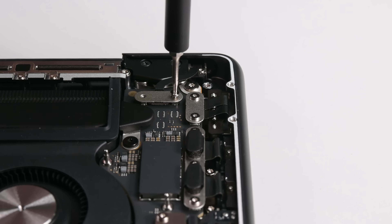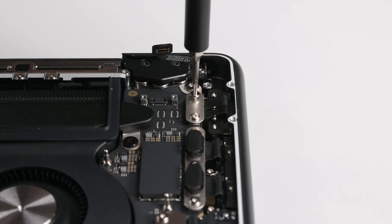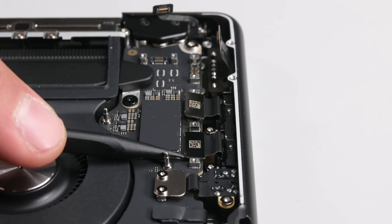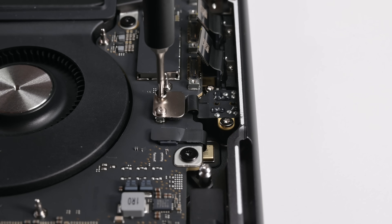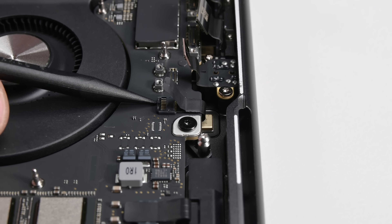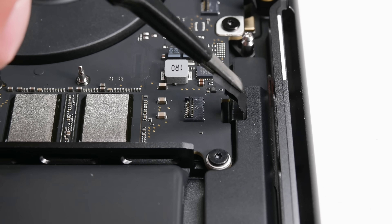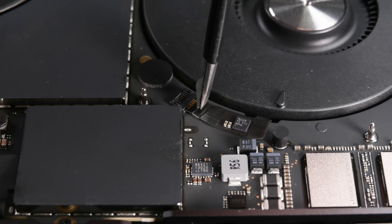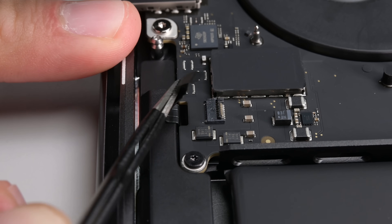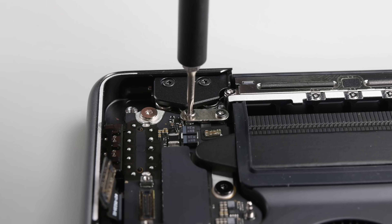Let's make a little room in here before we get to that battery and release the mainboard next. Starting with the lid angle sensor, I'm making my way around unscrewing screws, popping press connectors, and just generally living my best life. That audio jack is still around for now. Here I've got a ZIF connector for the MEMS microphones and one for the speaker, followed by the cables for the fans, the keyboard, and the other speaker. Lastly we have another port to disconnect and the Touch ID connector.